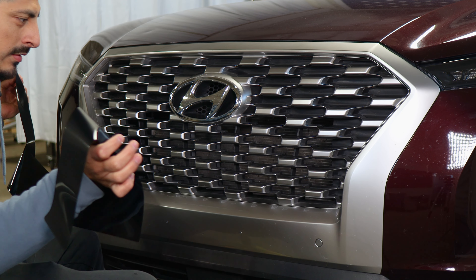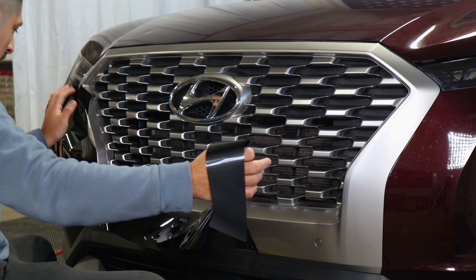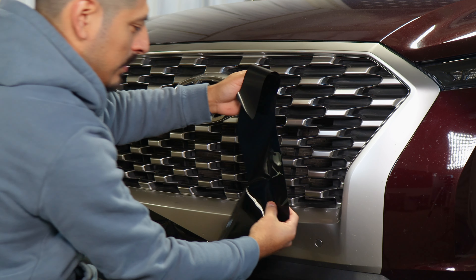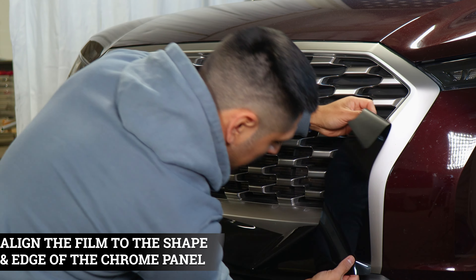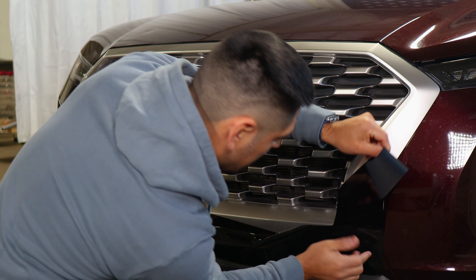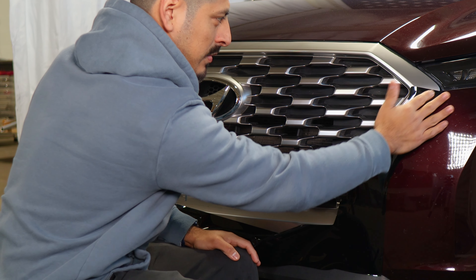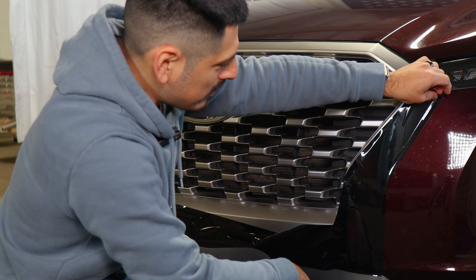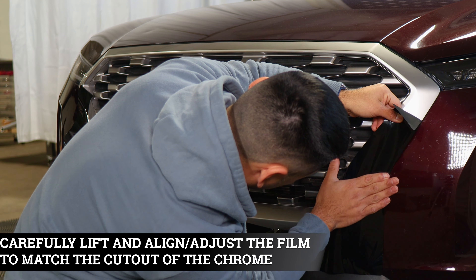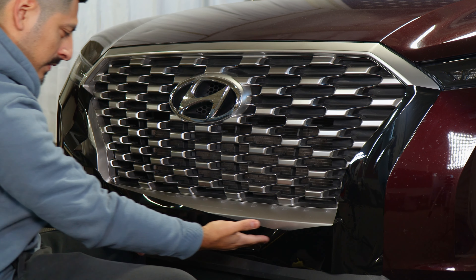Now that we finished prepping the front panel, we can start with the installation. We're going to start with the piece that covers the entire front section of the grille. Place the film onto the chrome panel so we can work on one end. You can work from either side — it doesn't really matter. Just make sure wherever you start, you align it to one edge, making sure you're covering the chrome on this side and on the lower section as well. Carefully make your way to the top, and if you need to lift the film to readjust it, you can. As long as the whole chrome is covered and you have enough material to cover this side, you should be good. Once everything is covered, finish tacking down the rest of the panel.